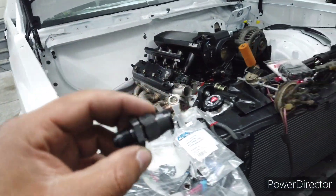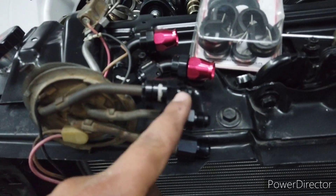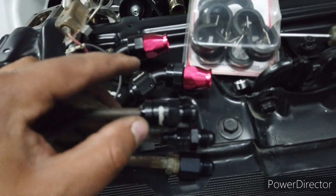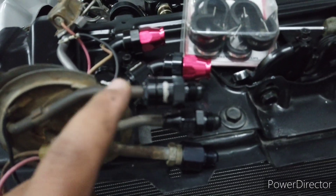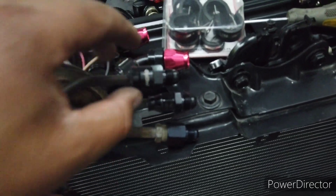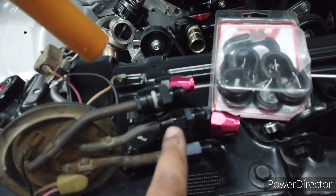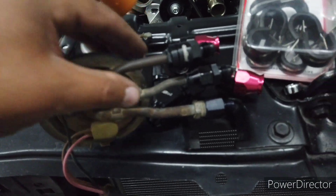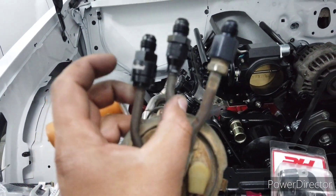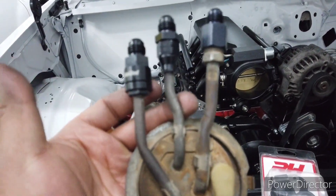The compression fitting didn't work on the return line but it did fit on the vent line. For the return I ran a different style — similar to what you'd use on a stock fuel line with a little ridge on the tube. This is currently the vent tube but it'll serve as the return since it's a little thicker. I did have to cut the tips off these two lines; I tried a tube cutter but couldn't make it work, so I used a cutoff wheel for a clean cut then cleaned it up with a file. Keep in mind these top two tubes are originally close together, so you need to spread them out slightly — just spin one outward a little and it'll work fine.